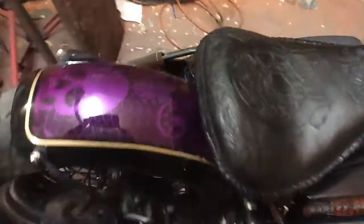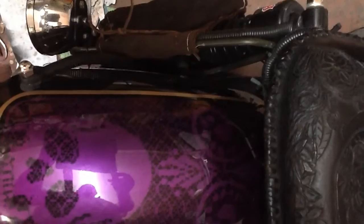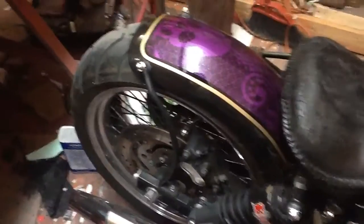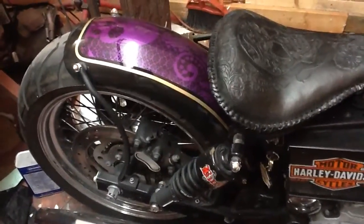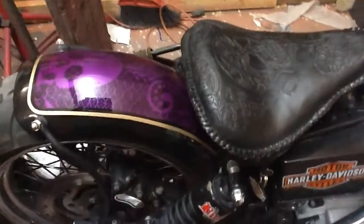What I did is I played around with spacing and I notched the swing arm — which you can't see in this light — and then butt welded it back up with a small plate so it's as strong as ever. But I do have the necessary clearance now to clear my sprocket, and it moves the belt out just enough to clear the tire.